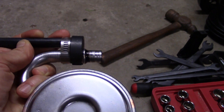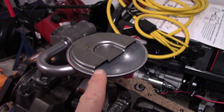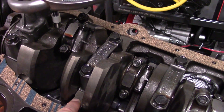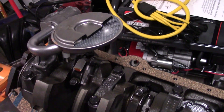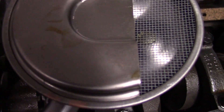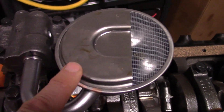What Melling has you do is measure the depth of the pan where the screen opening is, then measure back up to the engine, and then measure the height from the screen down to the pan rail. They want it to be 3/8 to 1/2 inch from the bottom of the pan. In my case I managed to make it a half inch, though it's not quite flat from one side to the other. The reason I ruined it the first time was I hadn't marked far enough back to see it when I had it driven all the way in, and I was having trouble seeing the mark — drove it in and got it too far out of position.